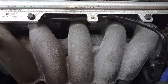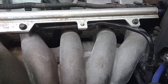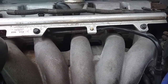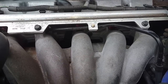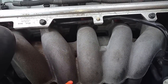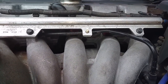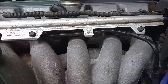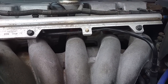What you want to do is start the car and spray around the edges of the intake manifold gasket. While the engine is running and you're spraying around the intake manifold and other intake lines, if there's a leak or a part of the engine is not sealed properly, the idle should change — it might rev up or something like that. So let's start the vehicle and see how this is going to work out.